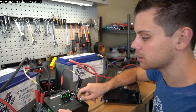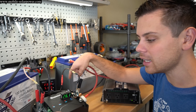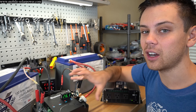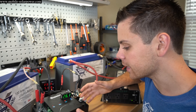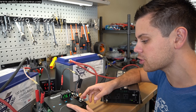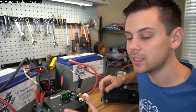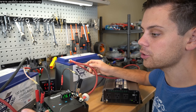I really like this system. There are multiple wiring options — you can use a common ground tied to the chassis and then just run positive wires for each source, which I'll diagram on the website. I'm particularly excited because I initially worried the ignition input meant it required a wired trigger for normal alternators, but that's only needed for smart alternators. For standard alternators, everything is fully voltage sensing and automatic — just connect the cables and you're done.